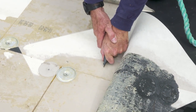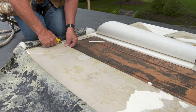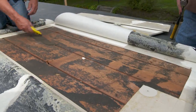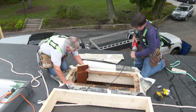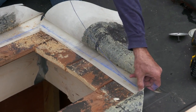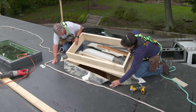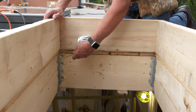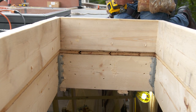Let's do a rough cut. I want to get this ISO board out of here. This underlayment — it's actually called an ISO board, which is an insulation — we don't need it in the opening. Cutting it oversized a little bit, we should be able to see what we're doing and see the structure. Now we're going to remove these two center boards so we can get some more accurate measurements for our rough opening. Get the boards out of the way and take our measurements. Slide this under the rubber. We're going to space our header about three-quarters of an inch between the header here and this header on our curb. We've centered it in the opening at the top. Now we'll just screw it down to the roof.